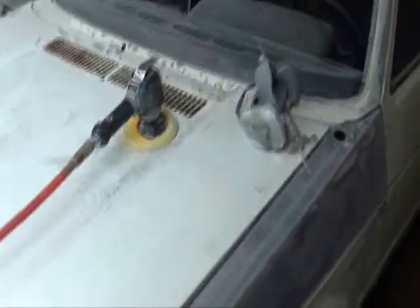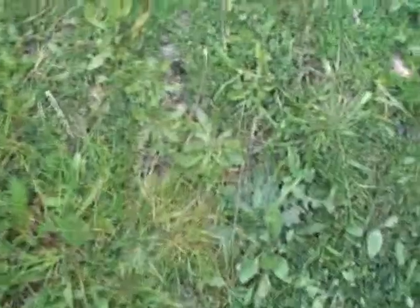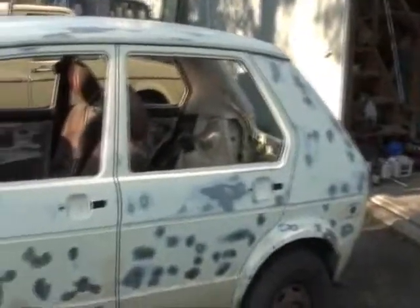That's what's going on here. It's just a long, long process — a lot of dust and stuff. I still have that hole underneath here to do. It's just hammered so that will probably be bare metal by the time I'm done, down under the grill and below. Thanks for watching. We're winding down here for the day — still sanding. I'm just trying to get through the rust bits and I've got to feather all this crap out. I've pulled it out to blow some dust off. Mostly sanding by hand, a little bit of DA work.